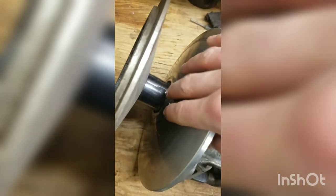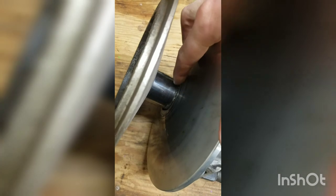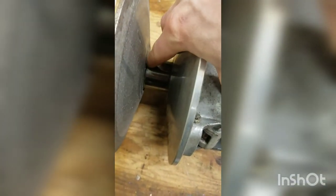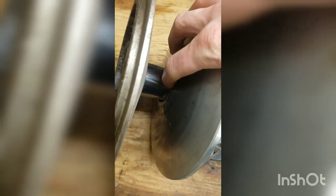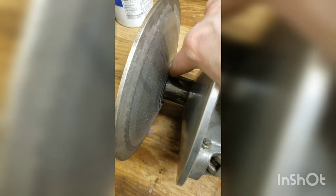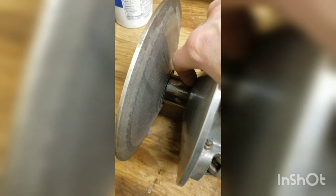The movable sheave has plastic parts. It's got a fiber bearing in it that you'll ruin if you heat it. We're just taking it off so that we can go through it. We don't necessarily want to replace all those bearings unless we have to. So try to just make sure the heat's only on the one side when you do that.